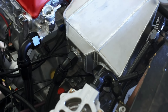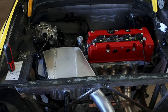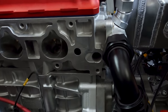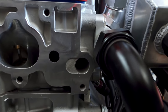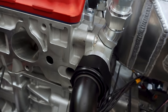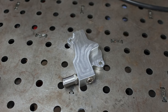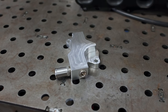Minus some mounts, it can sit here and we can operate the car without too much trouble, and I'm really happy the way that it's turning out. But there is one other aspect we need to finish before we can put the manifold back on. If we take a look at the cylinder head right next to where the intake manifold attaches, you'll see two holes right next to the intake runners. The bigger is an EGR port and we can ignore it, but that small, relatively unfinished one is a coolant port, and we need to solve that - because if we were to run the car as it is, coolant will come gushing out. My intake manifold came with this adapter fitting, and it's meant to direct coolant from that port down to the thermostat housing to circulate coolant through the head while the thermostat is closed.